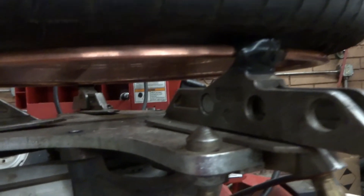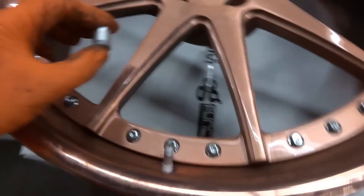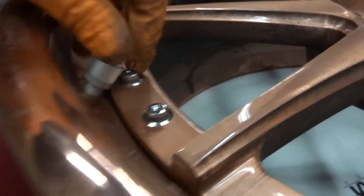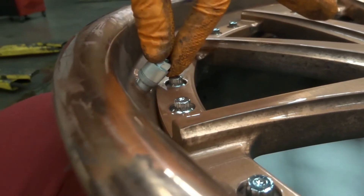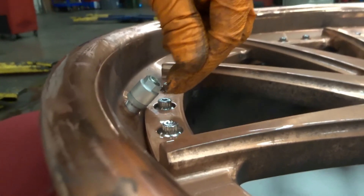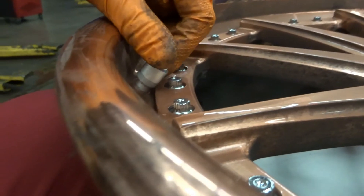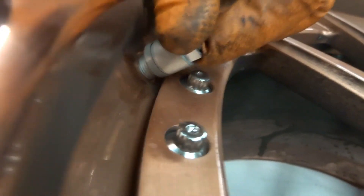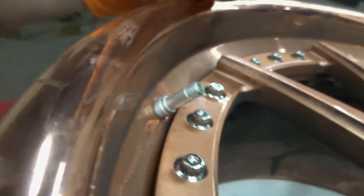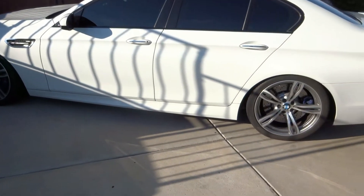With the bead broken down — there you go, that's how you do it. There's that barrel nut. Let me see if I can hold the sensor in with my leg — try to put the barrel nut on and it hits that face. So right in there is right where it needs a couple millimeters taken out, just a little notch, and then that should slip right past the edge of the face and be able to seat against the barrel like normal.